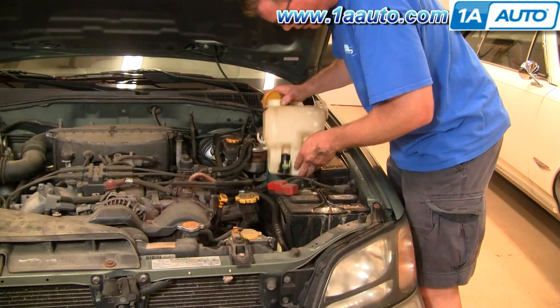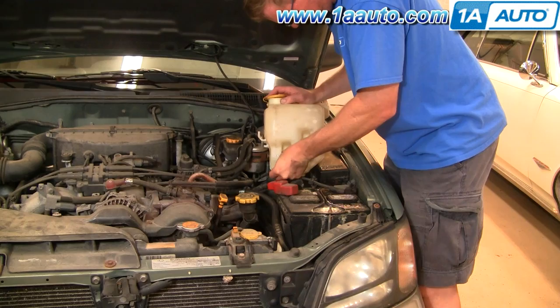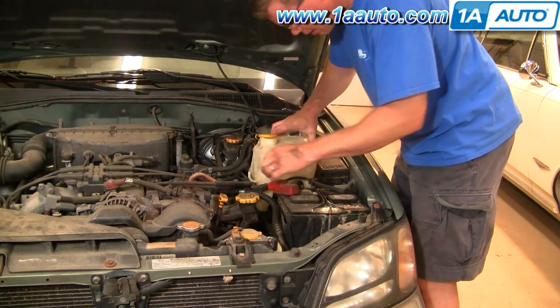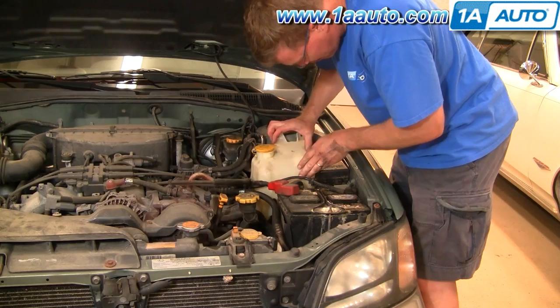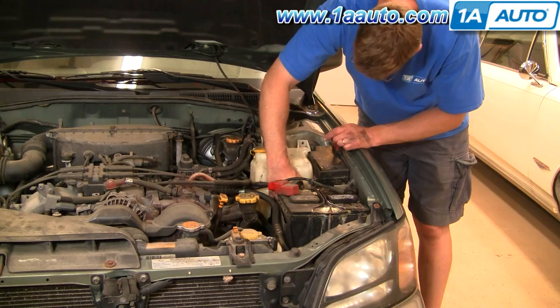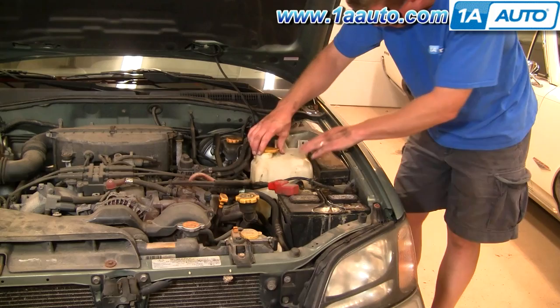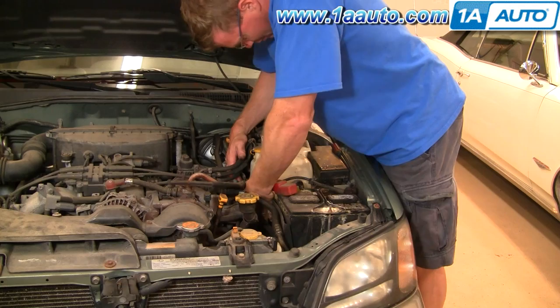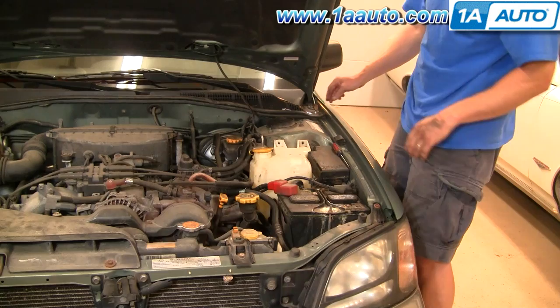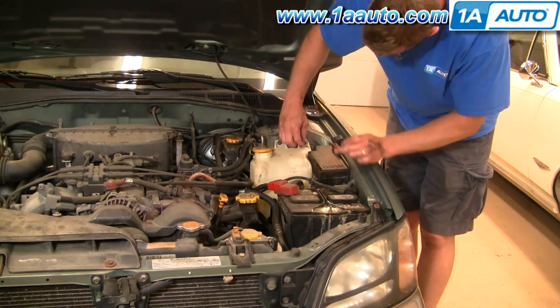Put this down again and hook up this hose. Put this hose up, plug it in, push this down and in, and make sure it goes down right in there. Connect the green one, which is further inside, then connect the natural colored one. Bring your tube up and hook it into the side here, below that hook, and set it down in. Now I'm going to fast forward as I start those two 10 millimeter bolts in at the top and tighten them up nice and firm.